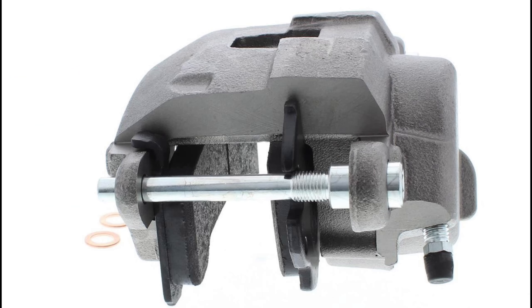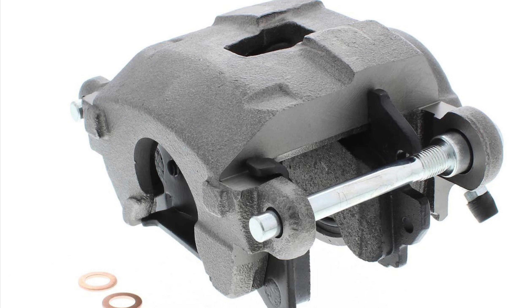I haven't showed you guys the brakes, which I kind of made a brain fart when I ordered. I wanted to go with an upgraded brake. The kit comes with brakes so I just said send them to me, not realizing I could have left them off. The brakes they come with — it's a GM metric caliper, which is the common caliper that was on every GM vehicle from about 1978 to 1988, and I think they still used them up to 2002 on some vehicles. It's that basic single-piston GM caliper that's pretty common.